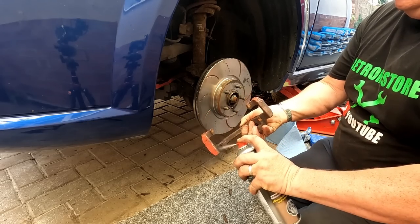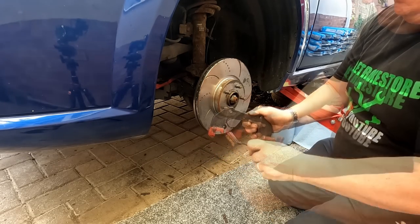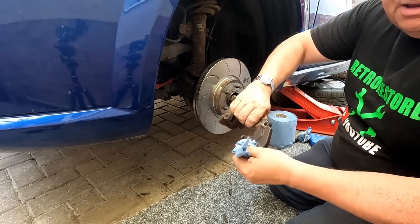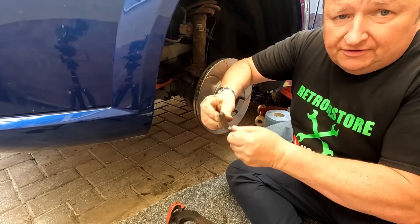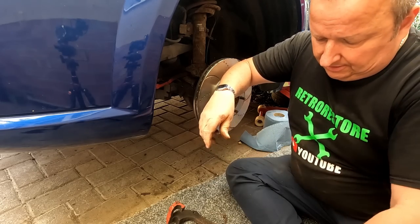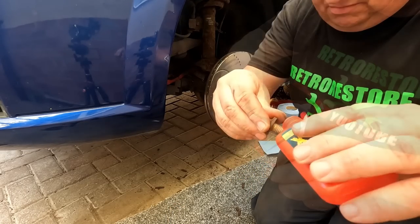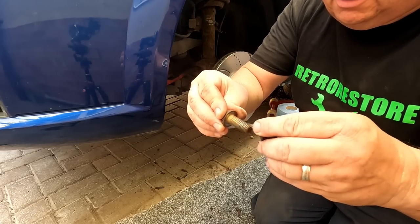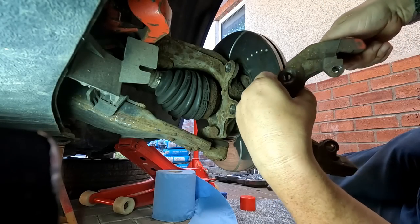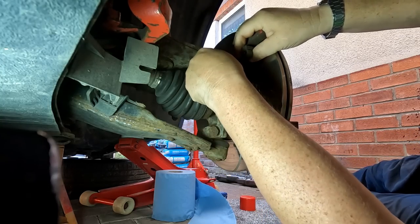So with this bracket — I was going to get all these powder coated and cleaned up, but I haven't got the time at the moment because I'm on a bit of a deadline, so I'm just going to give them a good clean up and do that at a later date. As long as the channels and things are clear, that's all I'm really concerned about. Now I've got these bolts — just going to give them a wire brush to get off any residue of the old thread lock. Then I get a bit of thread lock, roll the bolts around it to coat both sides without putting too much on. Let's get this bracket back on — it goes behind there — and in with the 15mm bolts and tighten them up with the breaker bar.